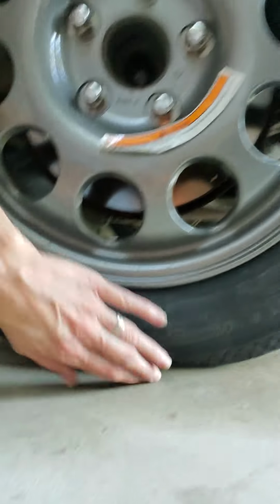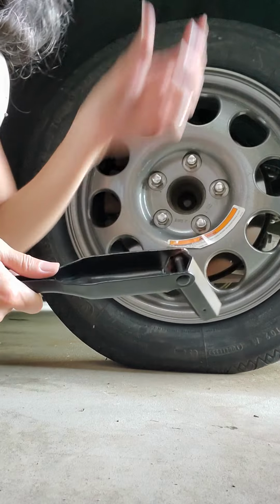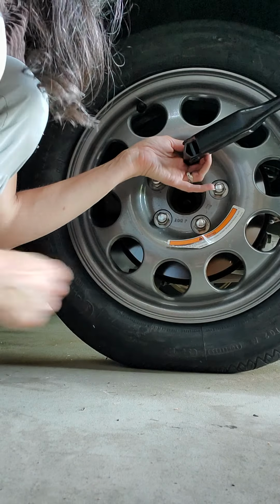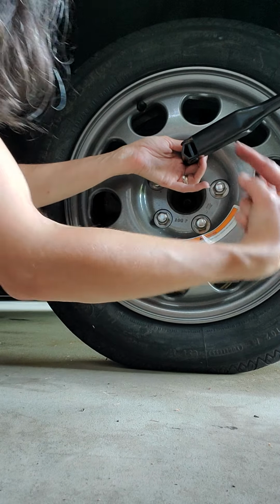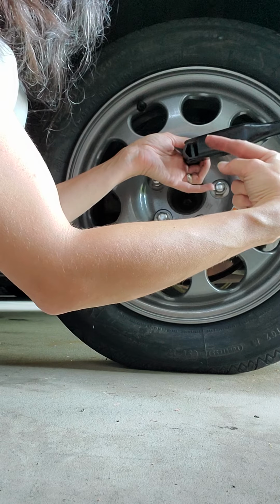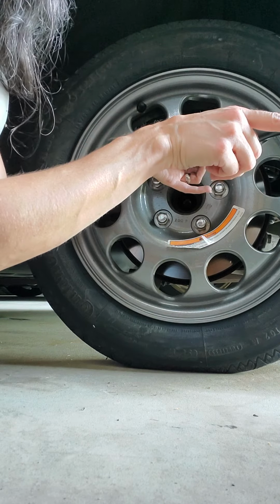All right, good. So my tire is on the floor, so now I can tighten this. Same deal with tightening. I'm going to tighten it with this first, and then go get my husband's torque wrench, because I just want to show you, if you didn't have one. So again, start with the top. And of course, righty-tighty, lefty-loosey. So go this way to loosen, this way to tighten. Towards the driver to loosen, towards the trunk to tighten.